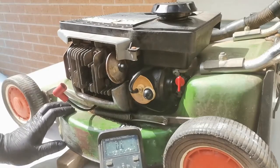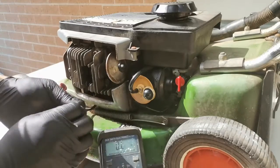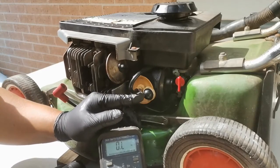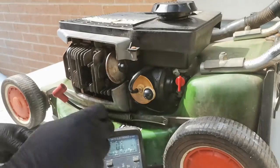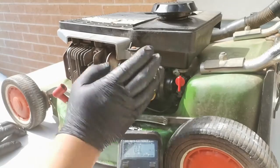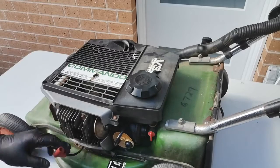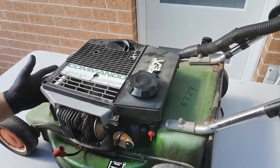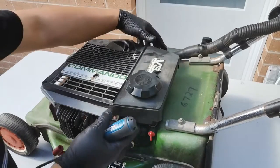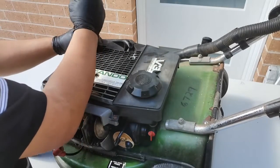Okay, for now you see that there's no leaking at all. So you see the difference and how good it is using the Brighton tip to quickly and easily fix that problem. So let's move forward, and we'll replace the ignition coil, and then we will rebuild the carburetor. To remove the ignition coil, we need to tilt this engine and remove the whole engine. But to be safe, it's better to remove the cowling and also the fuel tank. So we need to remove the cowling part.